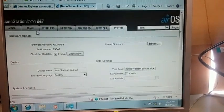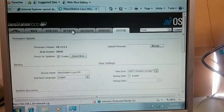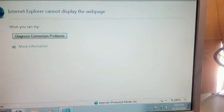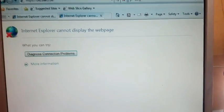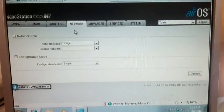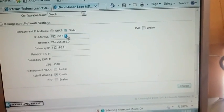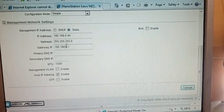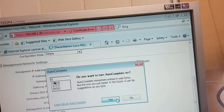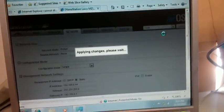Now we've got a new password. Go into the network settings — it's probably doing a quick reboot. Once we're back in, the next stage is to get this thing onto your common network. I'm just going to pick a random IP number which I had working before. Just change that and hit apply. You can do multiple changes in a row, but it's easier to do them one at a time so you can keep track of them.